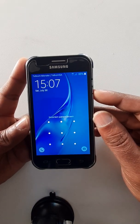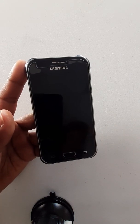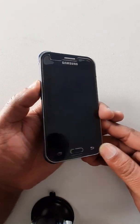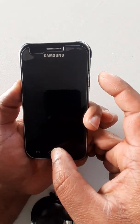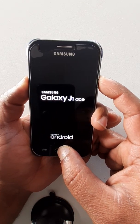Okay, power off the device. After power off, press and hold the Volume Up key and the Menu key, then press the Power key. Continue holding.